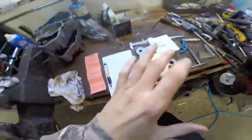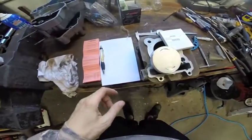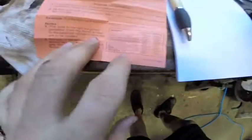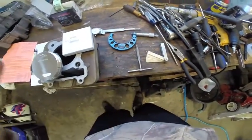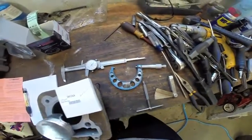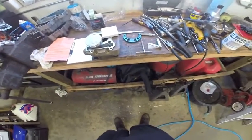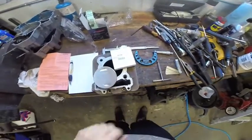We got some measuring tools here — we'll go over what's all needed. We have a piece of paper with a pen to jot down measurements so you don't try to remember everything. We have the ring installation instructions from Wiseco, mainly for the chart at the bottom showing clearance needed for your rings. We got our feeler gauges to measure ring gap, a telescoping bore gauge to make sure the piston fits our bore, an outside micrometer, and dial calipers. Depending on ring gap fit, we may break out some files to get a better tolerance. So follow along and we'll show you guys how to do ring end gap.